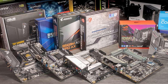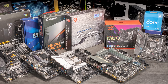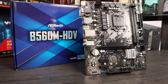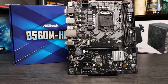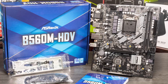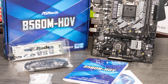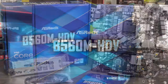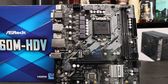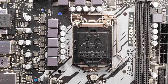All of these boards share some basic features common to the B560 platform: all are PCIe 4.0 compatible in the primary M.2 and PCIe slot, all have two M.2 slots in total, and they all allow RAM overclocking. Starting at what is unquestionably the bottom of the stack, the ASRock HDV has just two RAM slots and it's even been cut down from the normal mATX size, using just six mounting points instead of the usual eight. It doesn't have any post-code troubleshooting lights or a BIOS flash function. The rear I/O lacks DisplayPort and instead has both DVI and even a D-sub port, along with three audio jacks and just six USB ports. There's gigabit LAN but no Wi-Fi, and it has just one full-length PCIe x16 slot and two x1 slots. It lacks a USB 3.2 Gen 1 header, so many modern cases aren't compatible without an adapter. It has just four SATA ports, and there's no heatsinking on the M.2 drive or on the voltage delivery circuitry — but more on that later.